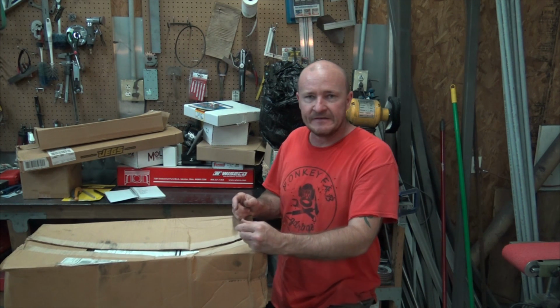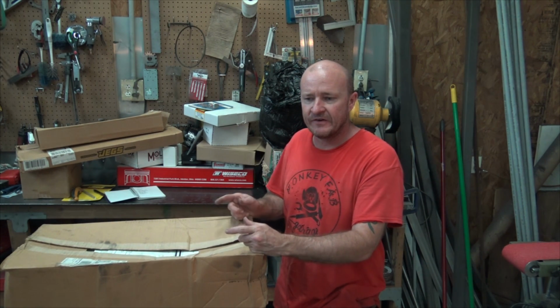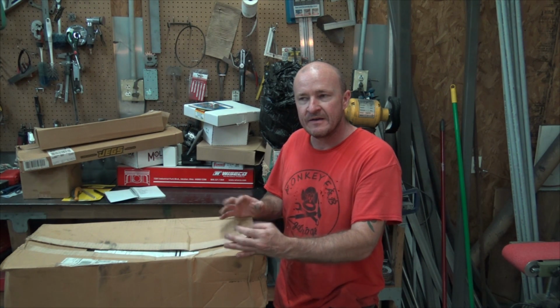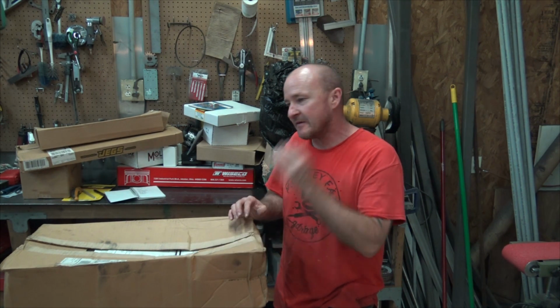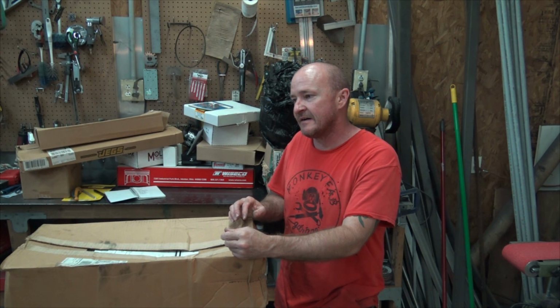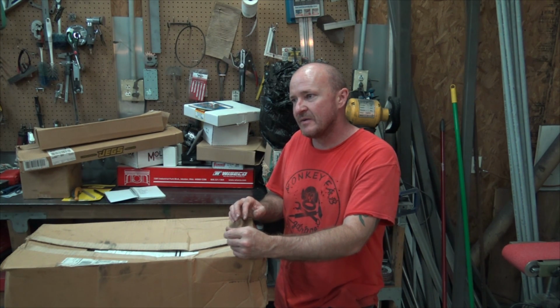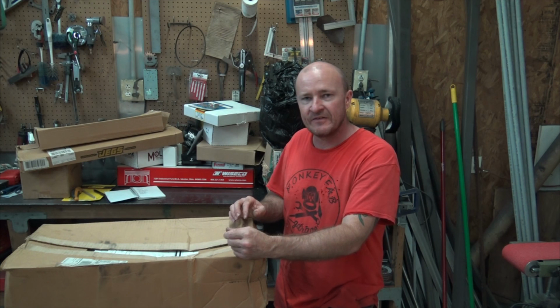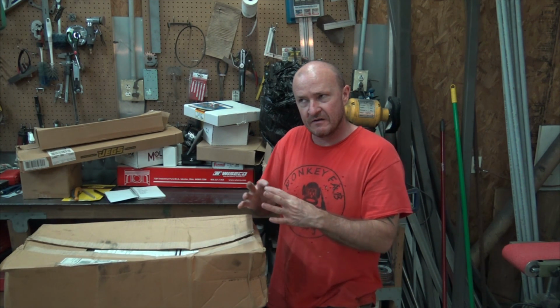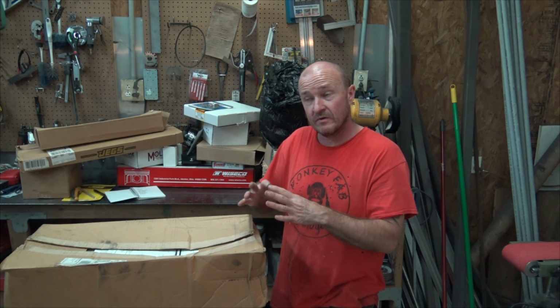My experience is that the stock stuff is good. So stock stuff in a block, leave it alone, run it, it's golden, right? Buying cheap parts was not the same experience. So I bought some cheap pistons and the rings that went with them, and they wouldn't even seal the cylinder. They were not concentric, right? They were elliptical, or am I saying that right?